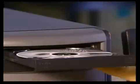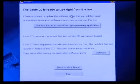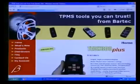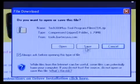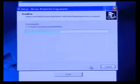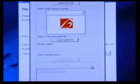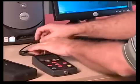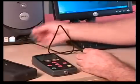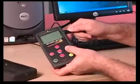First, download the application software from the CD included in the kit. From there, you can register on Bartek's website and download the newest software version. Once you have the application software installed, launch the program. Remove the rubber boot. Connect the USB cable to the computer first; while holding the Enter key, plug the USB into the tool.